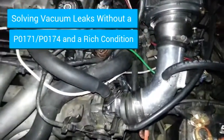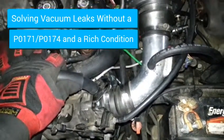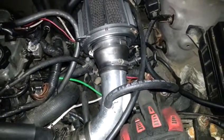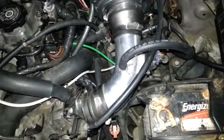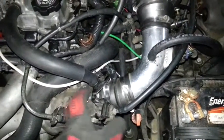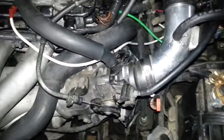So a little while ago, I went ahead and replaced this big guy, and I noticed immediately that some air that was getting past the MAF and not getting metered was actually getting metered, so that was wonderful. It gave my idle air control valve a little bit more control. Instead of staying wide open with extra fuel, it actually closed down a little bit and reduced things, but I still had a bit of an issue.